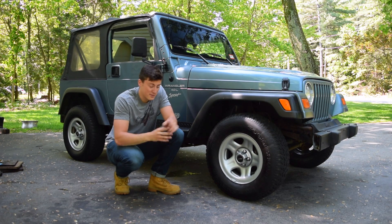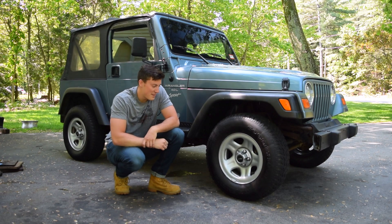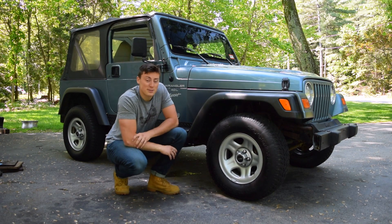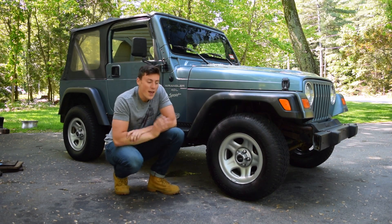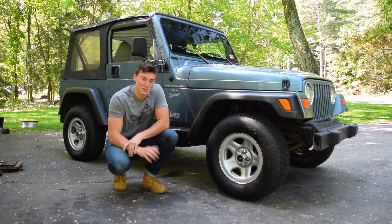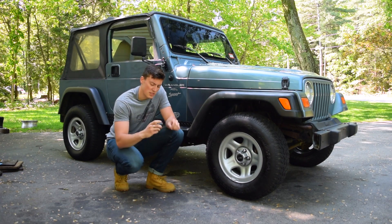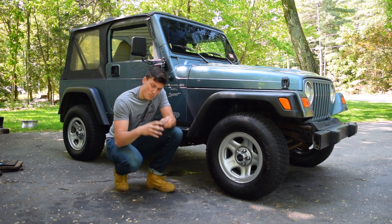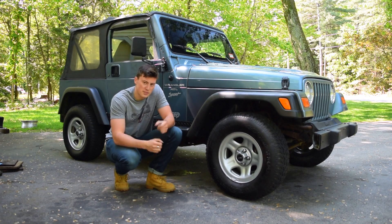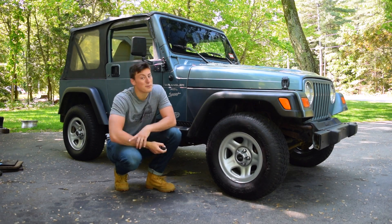Well, this is going to be fun. There are all sorts of little tips and techniques to get stripped lug nuts off — I'll just move to the next wheel. Every single one of those stripped as well. I said, wow, really having some bad luck. Moved to the next one — all those stripped as well. Finally got to the back driver's side and all of those lug nuts were stripped too. So you go to the store, get one of those emergency lug nut removal tools that spins on and bites into the lug nut, use an impact gun with like 2,000 pounds of force — and naturally, you break the tool. So now you know you're really in trouble.